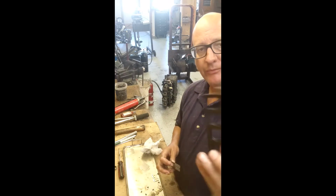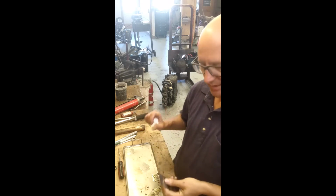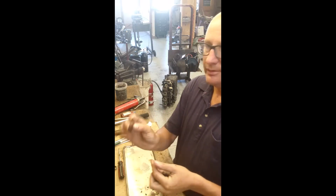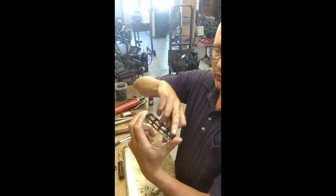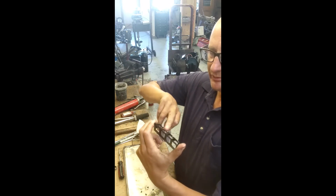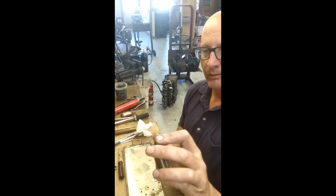So we've got the reeds off. They're all cleaned, just a little bit of dirt on them, basically paper towel. And you just pick out the way it's going down. There's a little imprint which way it went down. I don't really like to flip them over. You also inspect the rubber coating on this particular reed cage. They don't all have it. They have rubber coating. Make sure it's not cracked or chipped. I'm real fortunate that I have lots and lots of parts. I can always just go get another one.